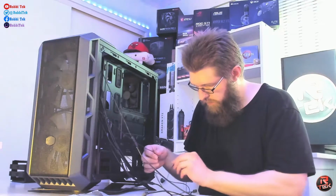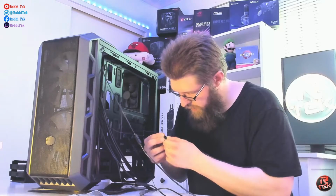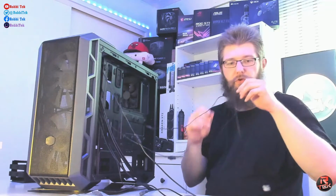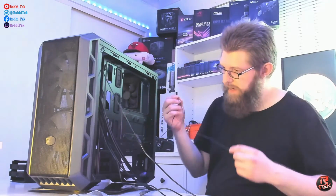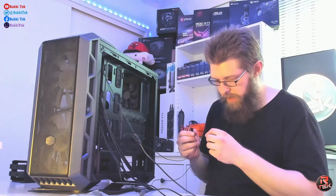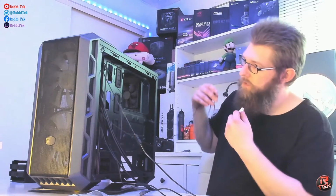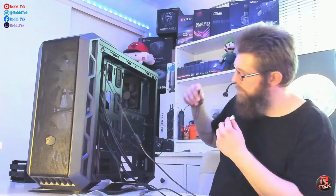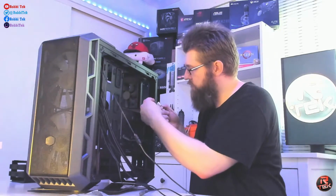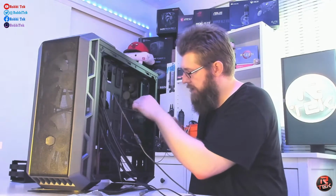Again, this one can be unhooked, pulled around here, pulled out of here and pop back in there, and now we've got a clear as day 2 fan connector ready for a fan connector, and also can be still cherry picked, linked with an additional connection itself. So that's for fans, bottom and top, not exhaust. Exhaust on the other hand can slot into this as well as a 3-pin, and then that can go onto the applicable header on the board itself, so you can control all of them.